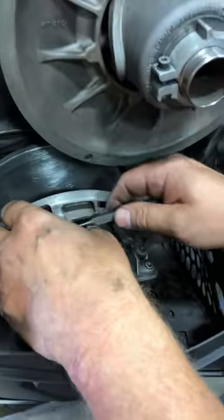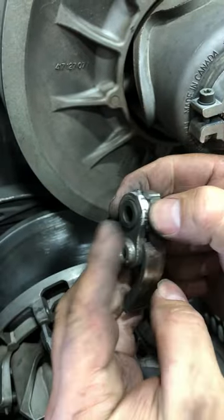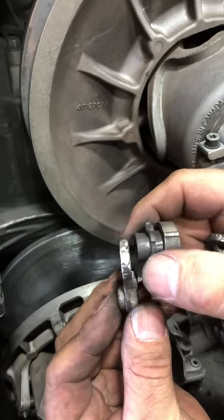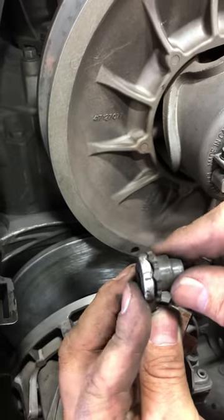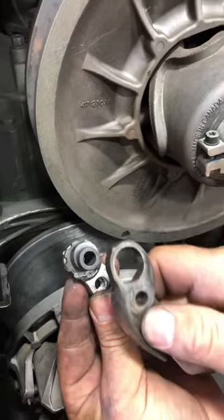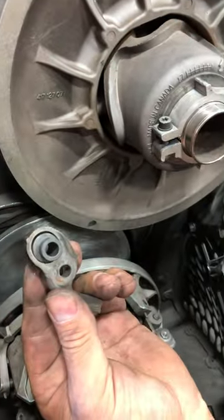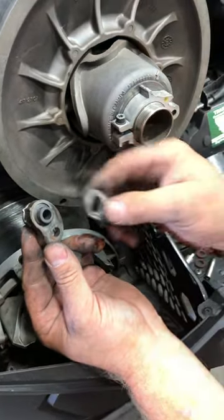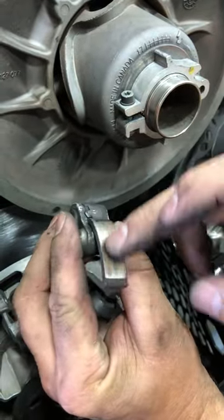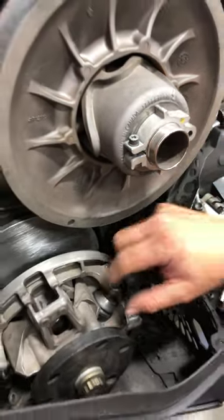This assembly is comprised of four parts and it's pretty self-explanatory how it goes back together. There's a spacer on each side, and that's where the weight screw goes in. Notice the detents in here — that's where the cam goes in and has to inset into each of these different rotations. Notice how that's an oblong shape, and our weight is oblonged as well. That's how you make an impact on how the sled performs. We'll clean this really well with number four aught stainless steel wool and inspect it for any grooves or flat spots.